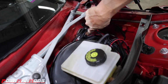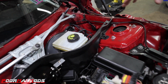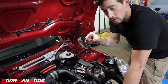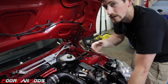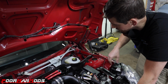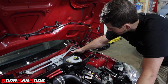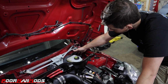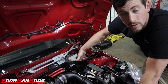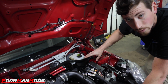So this grommet over here is where the wires are gonna feed through. The WOT box is not weather safe, so it needs to be kept somewhere where it'll be dry, and also because it has the serial port that you'll plug into your computer to connect it and configure it. I figured the easiest way to do that's sitting in the driver's seat. So we're gonna mount it inside the car, run all of the wires through this main grommet here, which is pretty easy to get to, despite the fact there isn't a lot of room. And then those wires are gonna wrap around, and there is down in here somewhere, we'll show you when we get to it, a good spot to run those wires through this semi-plastic firewall thing.